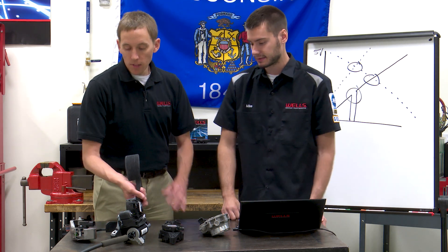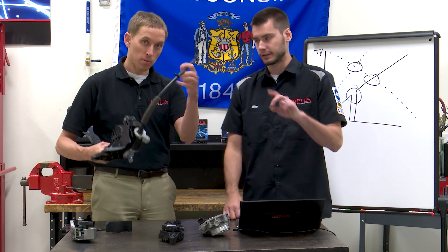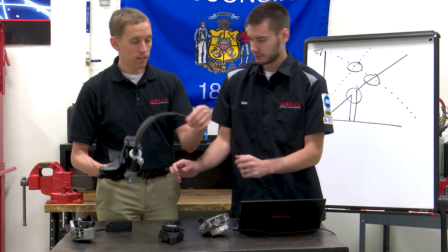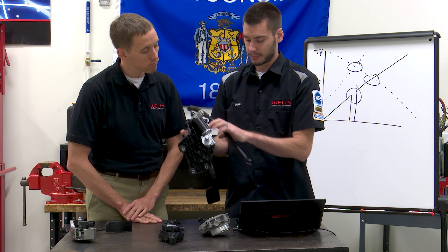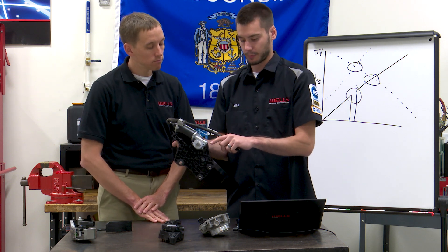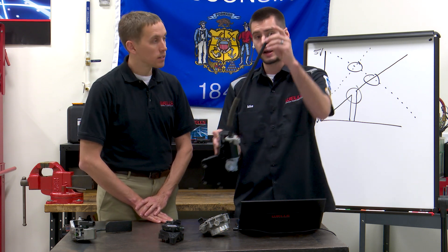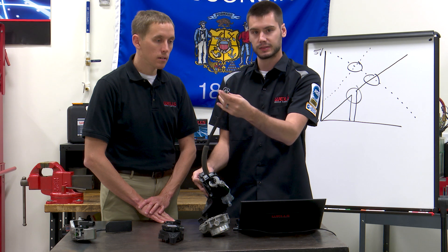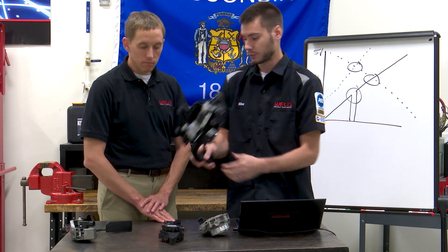Next we have a Ford — this is pretty common, it's a monster of a unit. F-150, Navigator, things like that, 2011-12. The big thing with this one is it's been set up for adjustable pedals. You've got the switch on the dash to bring your pedals either closer or further away from you, and this is why. This is still just a pedal position sensor, but this add-on unit back here is the motor that's going to move our pedal. If we give it power and ground, we'd see our pedal unit come closer or further away from the bracket. This cable here is not a throttle cable — it goes over to the brake pedal unit, and is actually driven by the motor to spin the brake pedal up and down also.